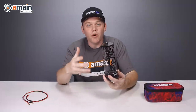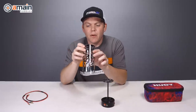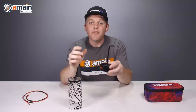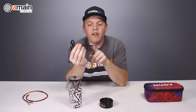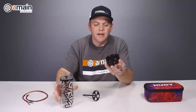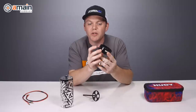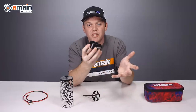Taking a look at the canister before we fire it up: it's made of four pieces. There's the plastic lid — kind of like plexiglass, not glass — and a valve on the top with an o-ring to seal it all up. The base pulls right up and is basically a post with a plate screwed on with an M3 screw. There are a few o-rings that seal the post into the vac system, and a big o-ring that helps seal the canister lid onto the base. Around the backside you have a couple of 4 millimeter bullets for the included lead, and a power button which is hold-to-power — you must hold it to power the unit and release when finished.